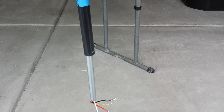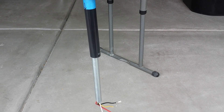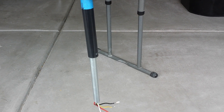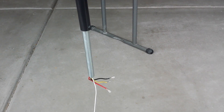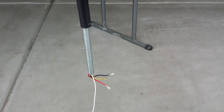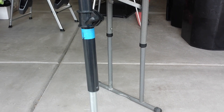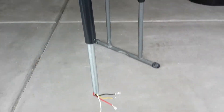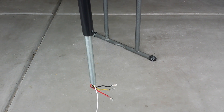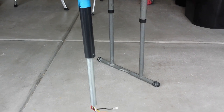I've taken a 12 inch piece of one-half inch diameter EMT tube and slid it up into the trolling motor shaft after threading the four wires through it. The reason I'm doing that is to make sure when I make my cut using a hacksaw that I don't damage the wires that are inside. Just bending the wires at the tip will make it fit in there. You have to make sure that the piece of tubing is long enough for your cut.